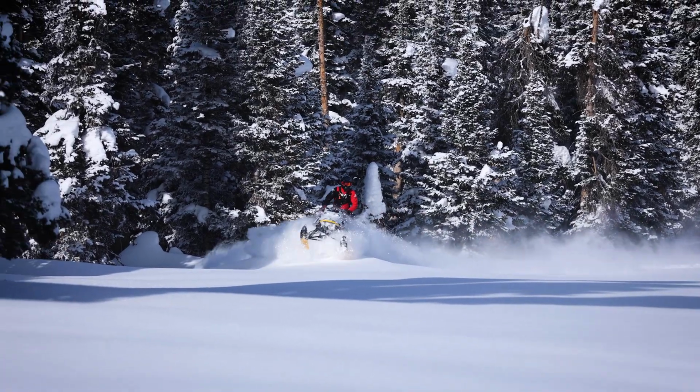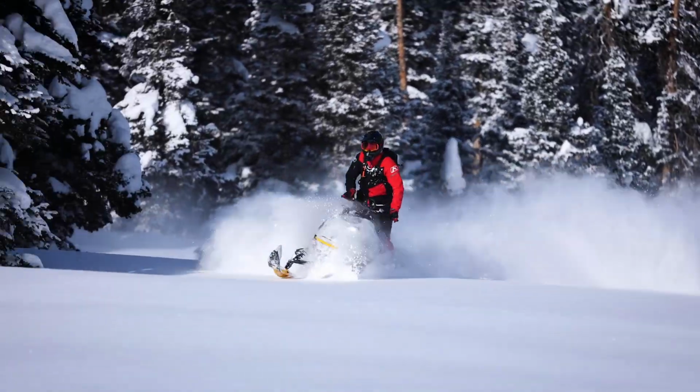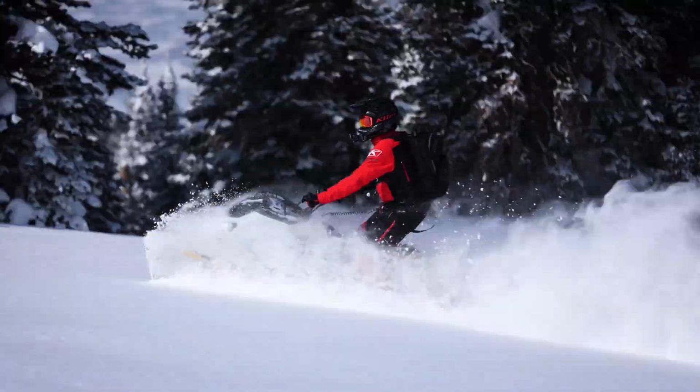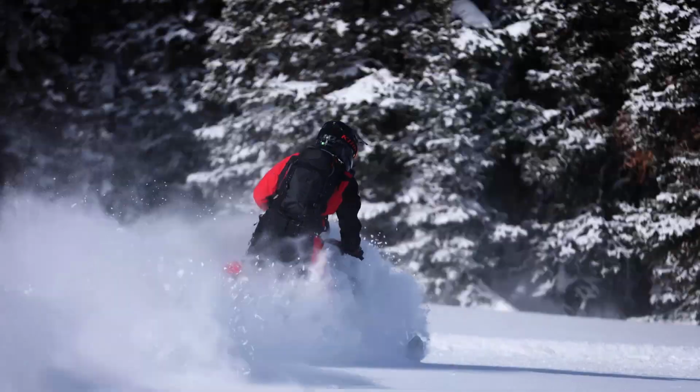and it really does improve the ride quality over the factory torsion setup quite a bit. It's very noticeable on the trail, but what I like the most is that it's progressive. So we're able to pick up all that supple small bump stuff and make it ride really good, but also because of the geometry change that we've made, it's progressive, meaning that it resists bottoming.